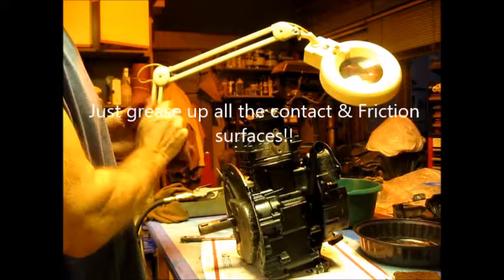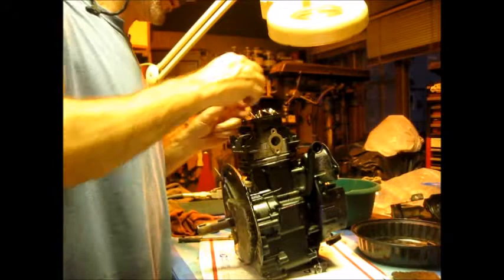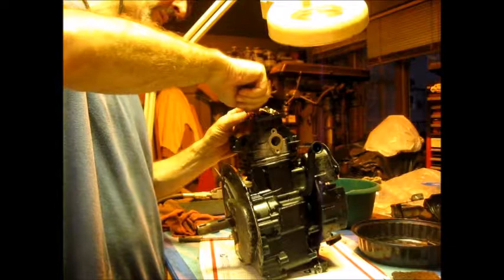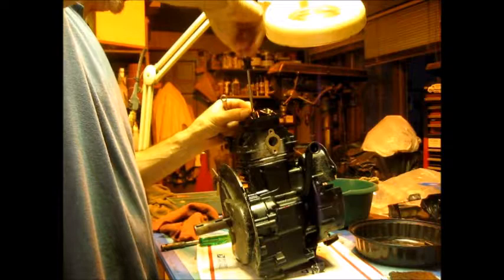The longer rocker is going to go up top — that's your exhaust valve. The shorter rocker looks like it's your intake. So we've got a Torx — I think it's a T10. Let's run these in, make sure there's lubricant on the threads. I think this is 10 millimeter — why is it always the 10 millimeter that you can't find? Let's take the set screw up and run these down. You take the clearance out — now there's no clearance; we don't know where we are.